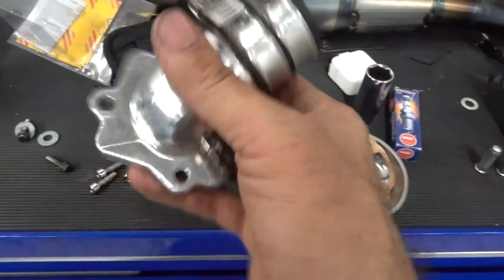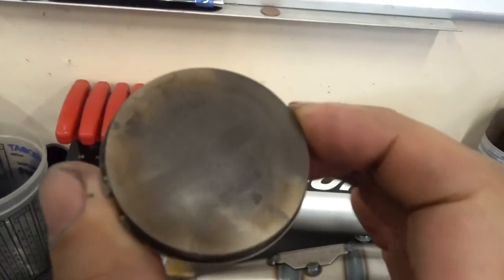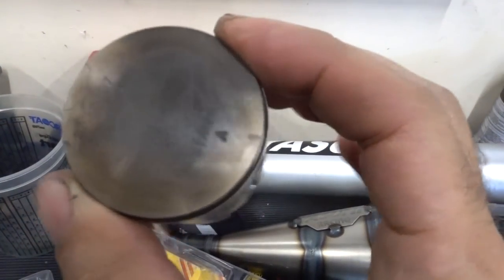Back to the scooter — I went ahead and took off the cylinder and piston in preparation for the liquid-cool cylinder conversion. Here is the Stage 6 Racing Mark 2 cylinder. You can see it's pretty clean, no problems there. Cylinder's pretty clean too — no scoring, no chips, nothing. Super clean, so this'll be a cool setup for another scooter if I build it. Also upgraded the intake manifold — swapped the little Voca intake for a Malossi one. The Malossi seems a lot shorter, puts the carburetor at more of an upright angle, better clearance, so I don't have to cut and modify my frame or subframe.